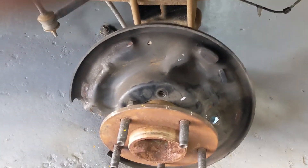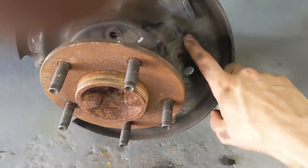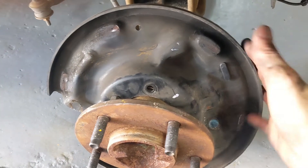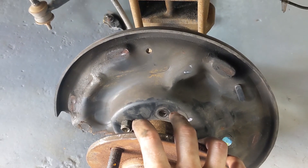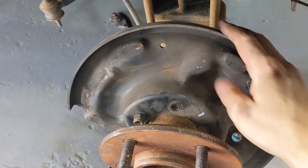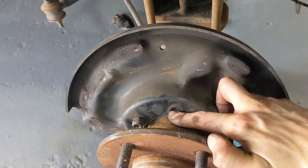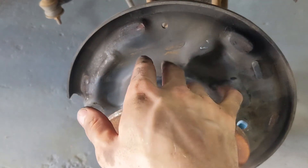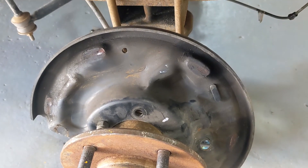Actually, don't rotate this 180 degrees — just rotate it 90 degrees. Because if you rotate it 180, there are a lot of bulges and whatnot on that side of the back plate and that's going to make it harder to cut through. Trust me — I know, that's the side I did. So only rotate it 90 degrees. Now, the problem with that: the flange is not a square, it's a rectangle, so only one bolt is actually going to even approximately line up. But that's fine — you can tighten it down enough, and this isn't going anywhere. When you do your cuts, try to cut to this bolt, because then you're only going to have a tiny little tab of metal hanging on. You'll be able to bend this back and forth and just snap it off. We're going to cut with the reciprocating saw as far as we can, try to get a good chunk out of there, and then finish it off with the grinder.